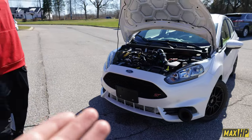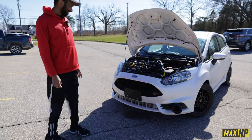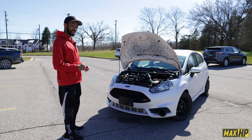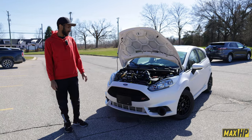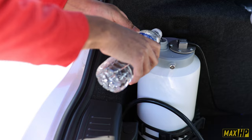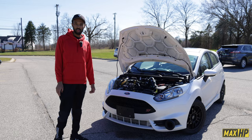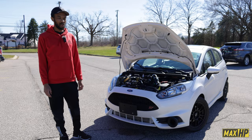So yeah, tell everybody watching what's going on down there. This is my custom intercooler sprayer. I made it entirely from scratch, and it uses quick disconnect fittings and rubber hoses powered by a pump located in my trunk, and my reservoir is sitting right on top of that in the trunk, a fully vacuum insulated 1 gallon bottle with a water level gauge.